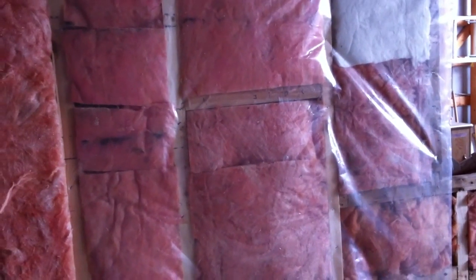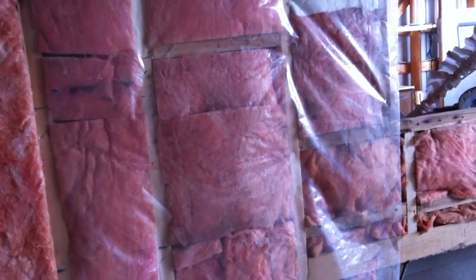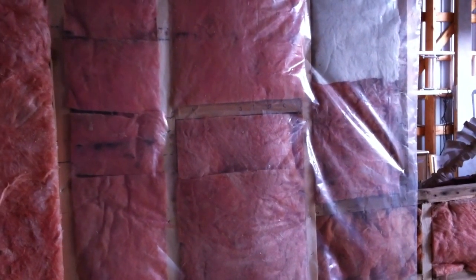I also use a wider sheet of vapor barrier, but only to keep my insulation in temporarily. Although I'm going to leave it on, I'm going to take a knife and cut slits in it so it can breathe — it's going to be shredded. It's just to keep the insulation in temporarily because the wires running behind it kept pushing it out. So do not use vapor barrier to make your trailer airtight or watertight. No plastic unless in small amounts and only on the corners to keep water out — that's pretty much it.